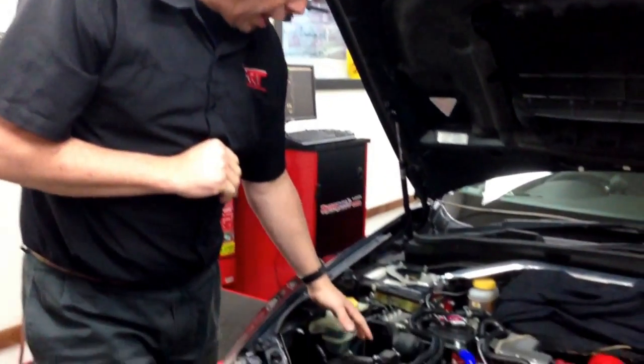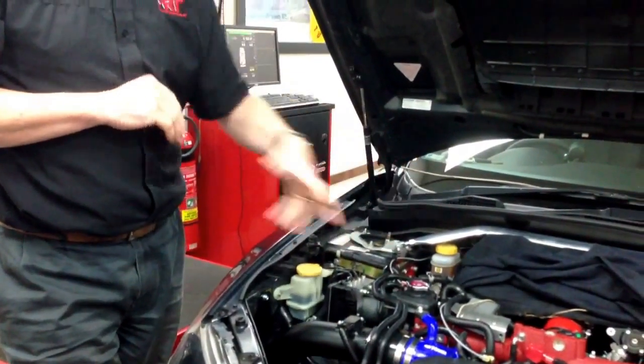You may ask why it has a modified air intake. Well, this particular engine is probably worth about $20,000 to $25,000, and when you're pushing big horsepower through these engines you do start running out of flow capacity with the factory standard air box, so you start having to run more modified air intakes. On a car without modified internal engine parts, it's only at the upper level of pushing big horsepower with standard internals on the STIs that you start thinking about needing a modified air intake — in most situations the factory standard air box is more than adequate.